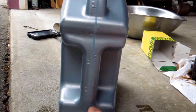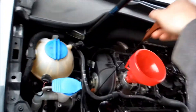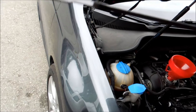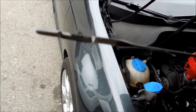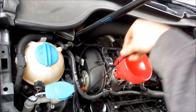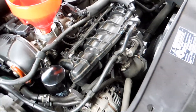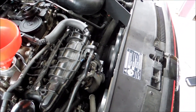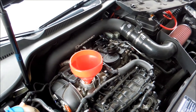What I did is go off the dipstick — it's at the top. Pull out your dipstick and you'll see some bubbles or ripples; just make sure it's at the top of the bubbles. That's the max. Do not overfill — it's always better to be a little bit under than over, because too much pressure is not a good thing. If you're a little under, leave it and drive around. Check it in a couple days to make sure everything's worked in.